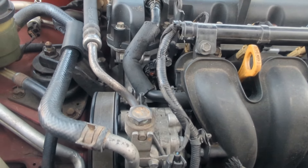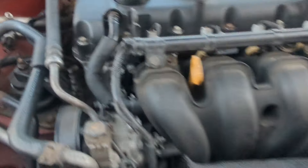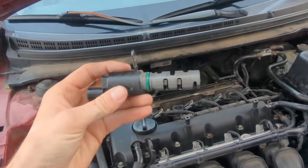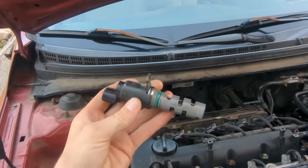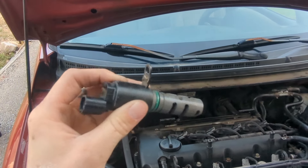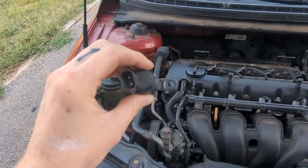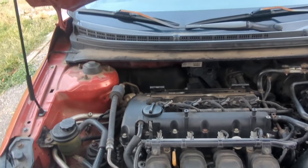There's just an o-ring holding it in there but it can be a little tricky. Definitely be careful not to bend on this because you don't want to snap it off. Kia is not the best quality stuff and I've seen a solenoid break off like this — not this solenoid but a similar one — and you do not want to be digging in there. Try not to bend up and down, just try to twist and tug on it. It should be a five-minute job if you don't have trouble getting it out, and it fixed my issue, hopefully it fixes yours.